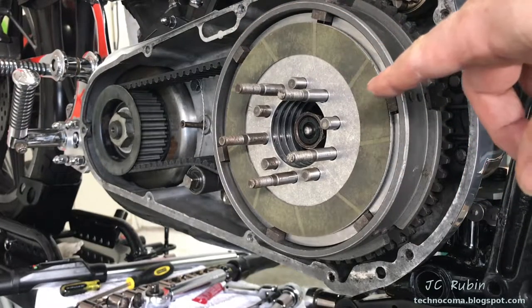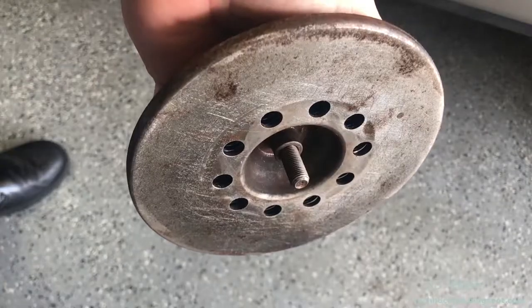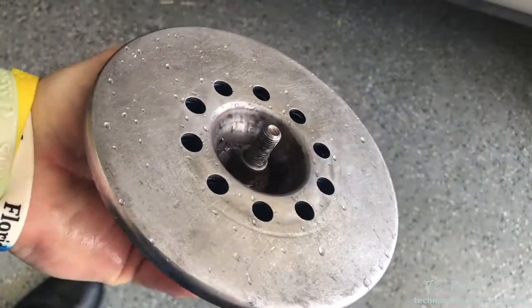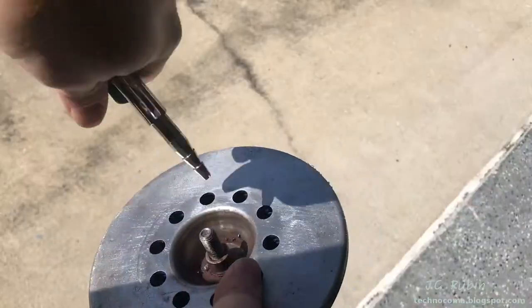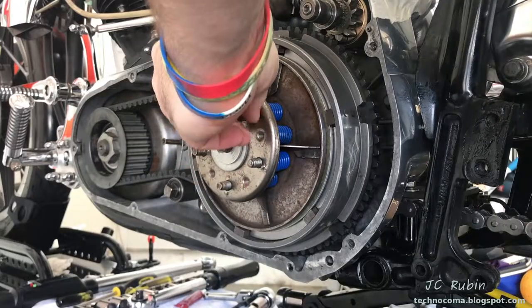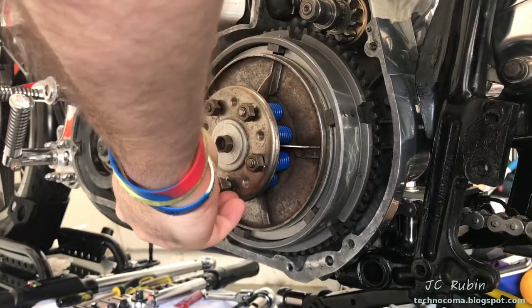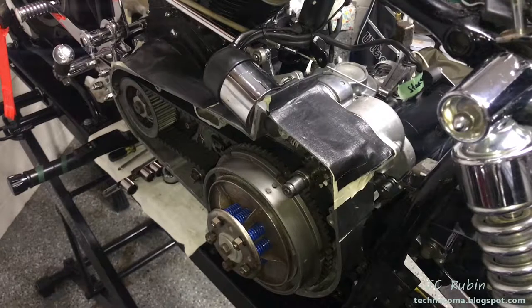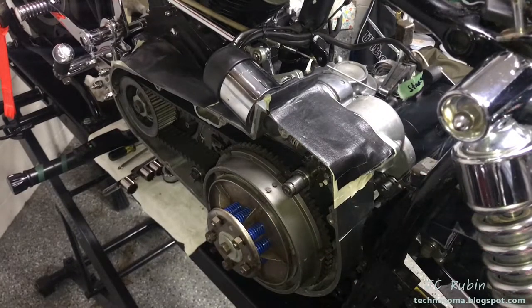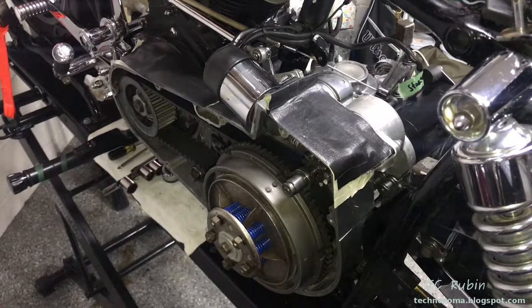With everything in place, we move on to the releasing disc. I first tried cleaning it with brake cleaner but saw there was rust, so I went with a Scotch-Brite pad and degreaser — it cleaned up really nicely. I blow it out with some air, let it dry out, then slide it right over. I put on the special locking nuts, ensuring I see at least one round of thread exposed. The locking side is pointed inwards. That concludes this chapter on the FXS Low Rider restoration. The clutch itself will be set up in the next video — hit the like button below, it helps a lot, and hit subscribe to be notified of more videos like this.